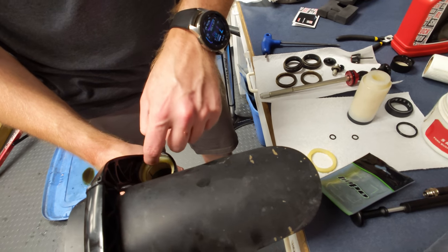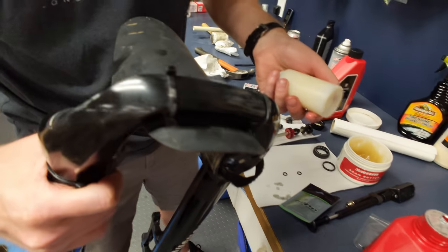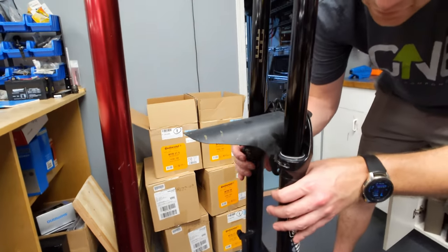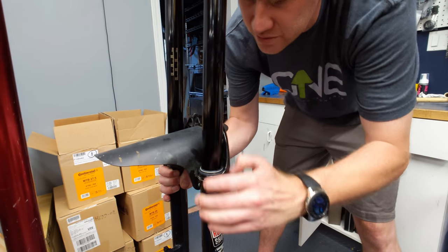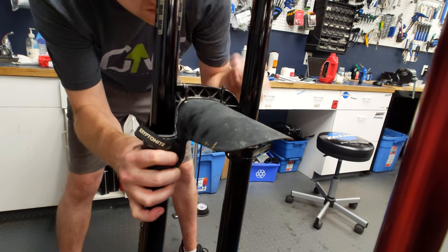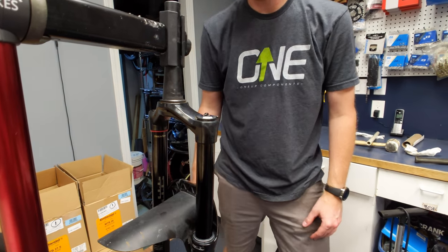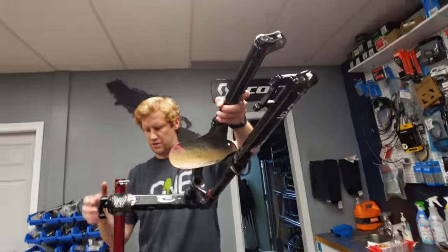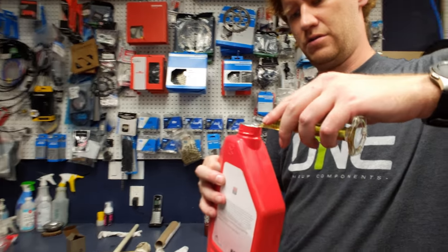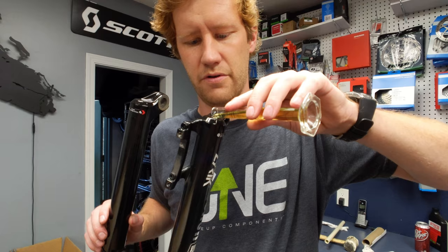It's pretty easy — just slide it in there, just tap it in. We just want to push that seal in. I thought you were gonna have to hit that with a mallet. No, I'm just really strong. So very carefully slide them up — we do not want to roll these seals and pinch them. We just want to get them in there one at a time. If you get it right they should slide easily; if you get it wrong it'll feel real frictiony and not good. Now we're gonna add some oil — these take 10 milliliters of zero-weight in each leg. Fill this up and dump it in — graduated cylinder, yeah. Put a little angle on it and give it a little dump, it should kind of cling to the side and go in there without going directly down the center.